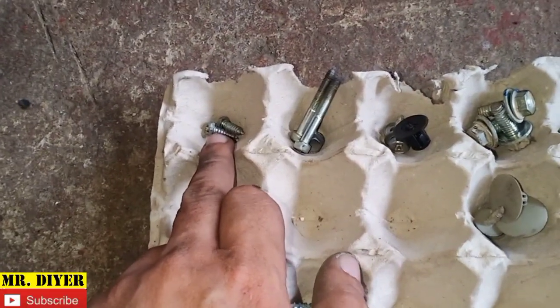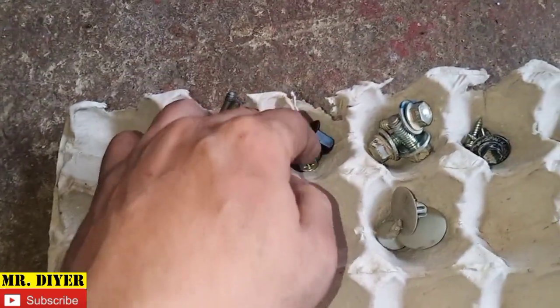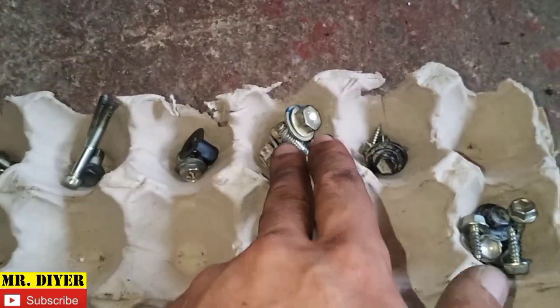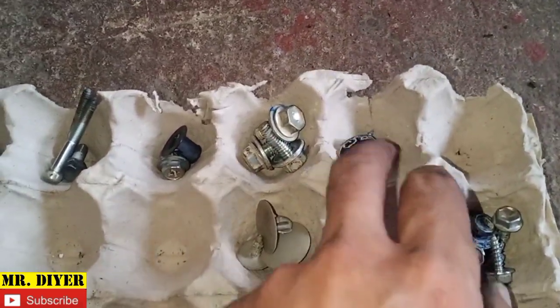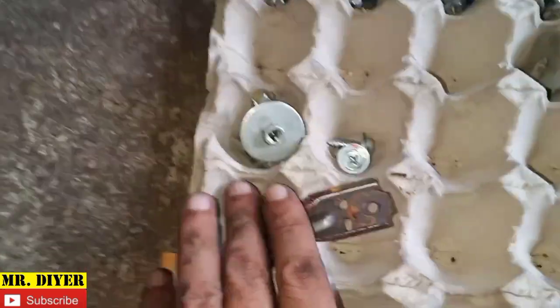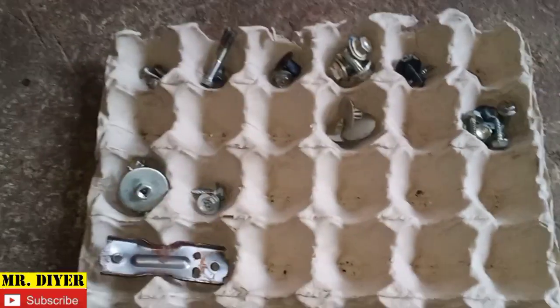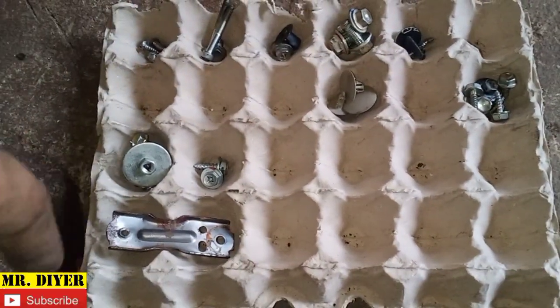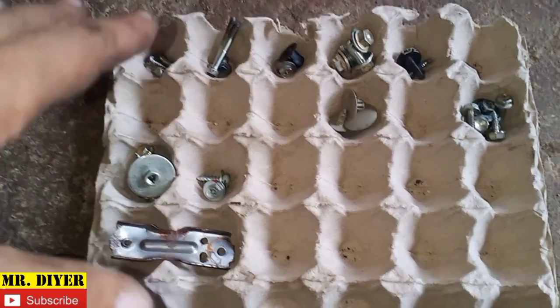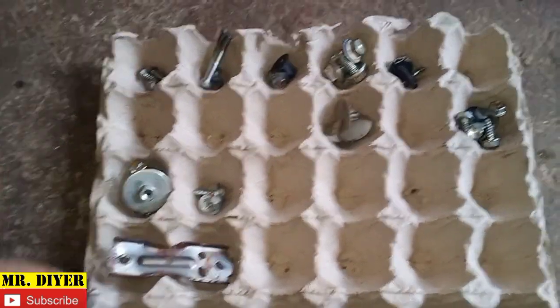These screws are for the blower motor, these for the expansion valve, these for the panel, these for the airbag module, these for the housing of the evaporator. See, there's order. These for the center console, and these are for the brackets of the blower housing. So you might want to keep that in mind. It makes putting it back together a lot easier.